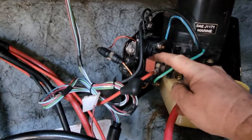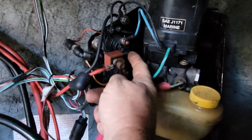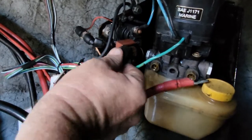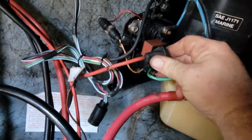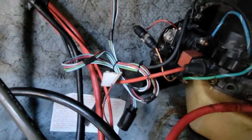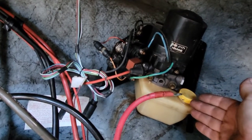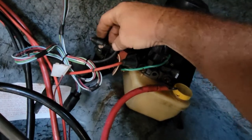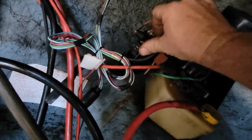This is another view with the block back on. It goes on one of these screws here on the solenoid, and there's a little bus bar between the two solenoids that feeds them with power. Stick the boot back up on here — you'll need both hands for that. The point is you do not want any movement on that wire. I went ahead and changed this pump onto a good bracket, and we're about to test these solenoids. I need to get this set up, plugged in, and jumped over to the battery.